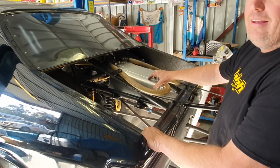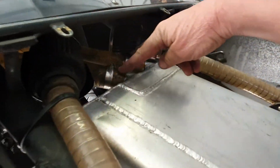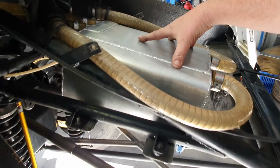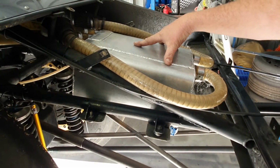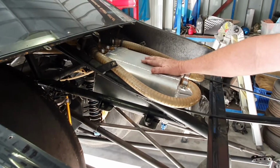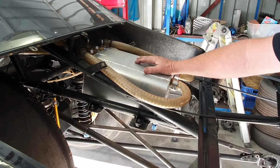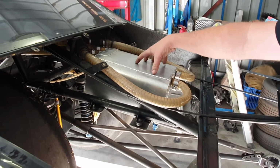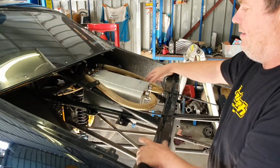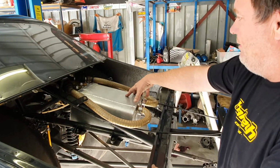So around the back here, what I was talking about with the puke tank, these two lines here where the puke comes out of the chassis rail and into this tank. This tank's around about 16 litres. It's really a mixture. When you drain these things, it just comes out like a soup. It's predominantly fuel with a little bit of oil in it, but it's very important to drain this every run, because this is when you see these cars hemorrhaging out of the back, if you forget to drain that. It makes a mess on the track and holds everyone up.